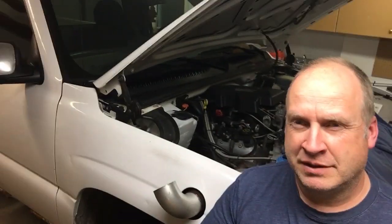Hey guys, it's Randy with Lobuck LS here again. In this episode I'm going to show you guys how to remove the fuel tank and fuel pump assembly from a Chevy Silverado — mine's a year 2000. The reason you'd want to do that is I'm going to be installing a new Walbro 525 Hellcat fuel pump, and the stock fuel pump is inside the fuel tank, so that's what we've got to do first.